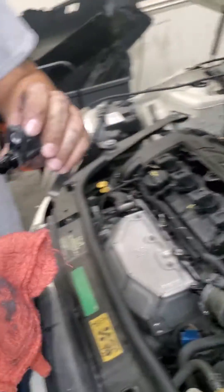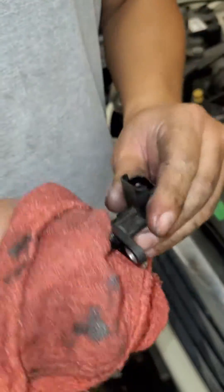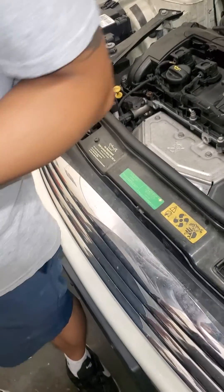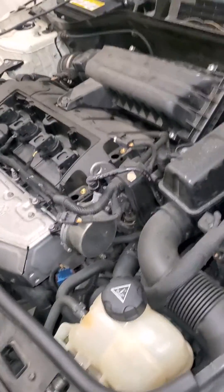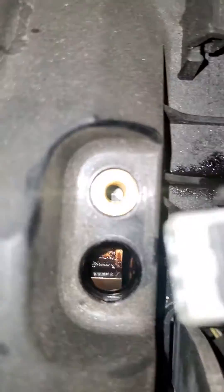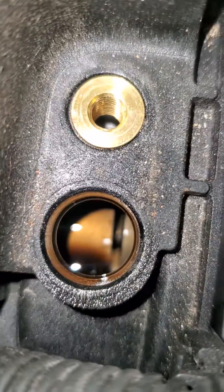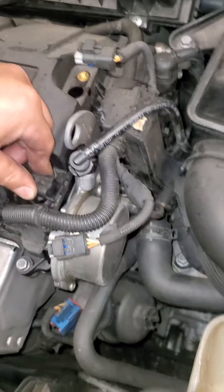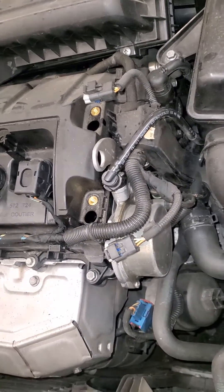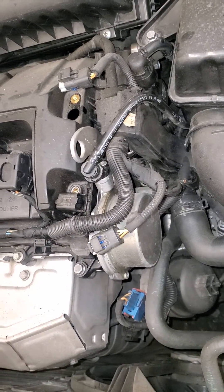Let's see what that looks like. This one's a little bit better — there's not that much shavings. Let's clean it off. Going to swap them. It could have been causing interference with the signal because of all the shavings and that piece of metal. But if you look in these holes, it doesn't look too bad. I may clean it and pop it back in, but for now I will swap them. So right now this is the intake side and that's going on to the exhaust side. Same size sensor. And then the exhaust is going over to the intake side.